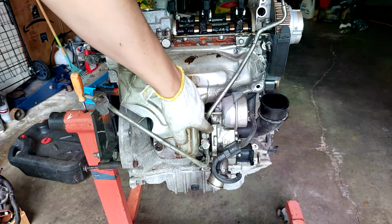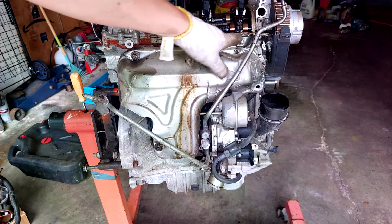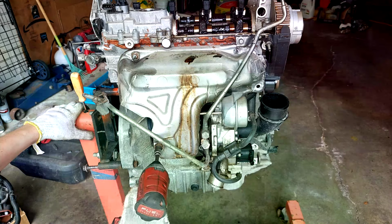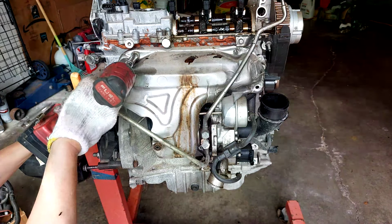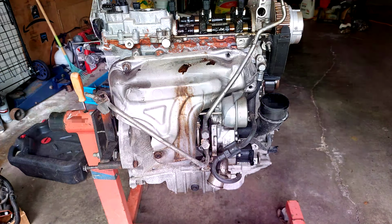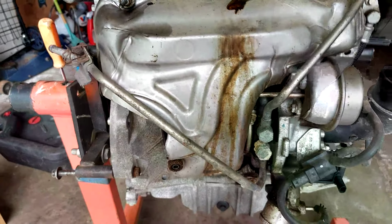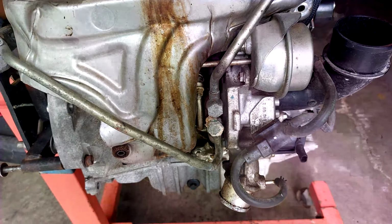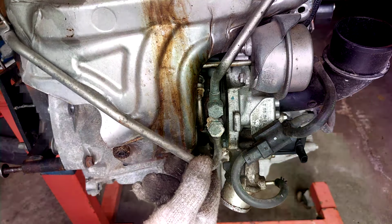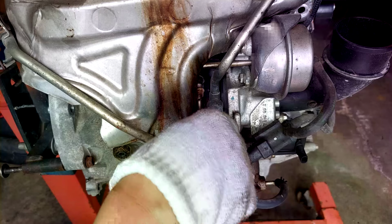probably a coolant line for the turbocharger. There's another one down here. Looks to be 8, 10, 10. That one's missing. Didn't break either. You might want to see that. All right, so this is either a return or supply for coolant. As you can see, it's been loose. Oh, look at that. It looks like it's been leaking something, coolant.